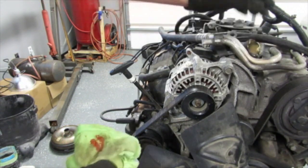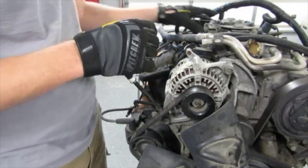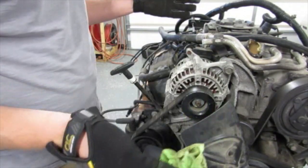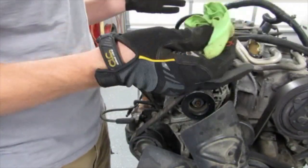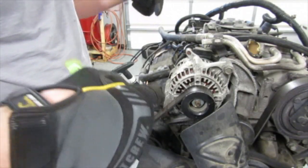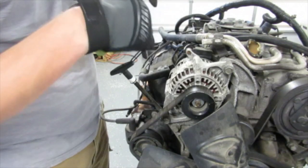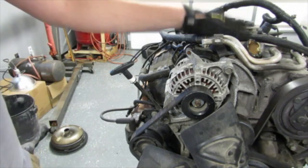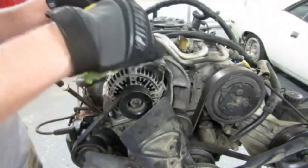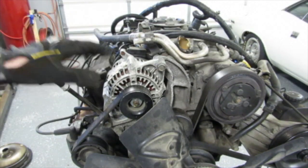And I do have a swap manifold for it. If you'll remember the Red Sled project, I either bought or he gave me that old intake that has a dual pattern, and we were using the side pattern, and the bolts were actually binding on the side of the intake and not letting the intake drop all the way down on the engine. So all I gotta do is move those plugs over and I can use the straight down holes for this. So that'll actually work out for me. So I've got an intake already.